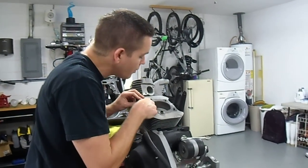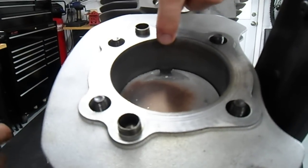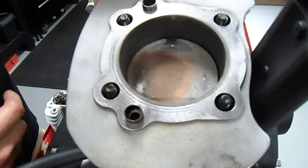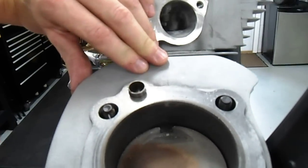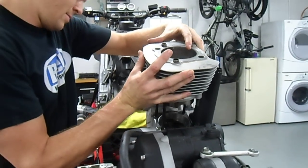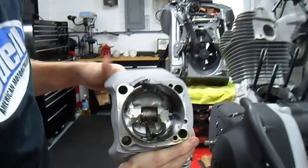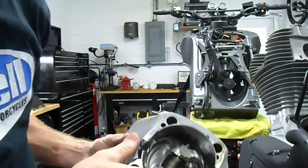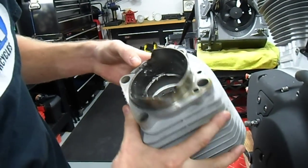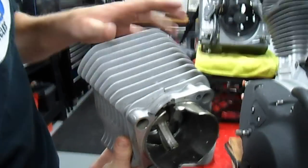You can see the damage in the top of the piston there — a lot of aluminum deposit from the heat. This cylinder is going to be the fun one to pull off because it looks like it's splintered. Look at that. There's part of the rod. Most of the sleeve here is broken off and actually the rod looks like it punctured through the sleeve and broke out the cylinder wall there.